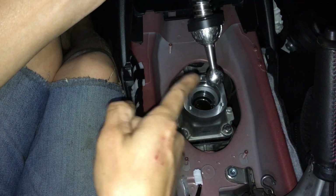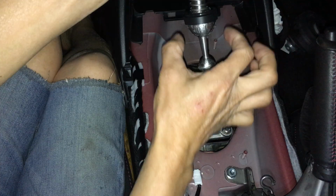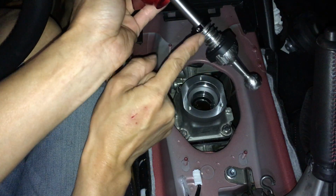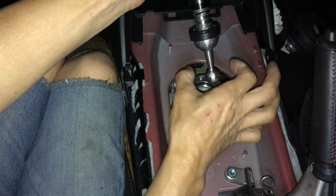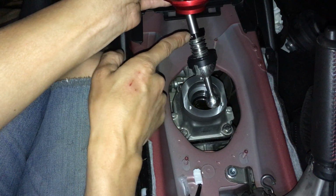There's an orientation with this ball as well, because there's 2 grooves, right? So the grooves are on the side, because there's those pins right here. There's a pin right here and a pin on each side. It has to line up with the groove, but I think looking at the pictures here, there's a little screw here that screws this ring on to keep the spring in place at the proper place. Looking at the pictures, I could have sworn I saw this face facing the driver's side, so it's like that. So there's the groove right there. So it should be like this, with that flat side where this little set screw is.